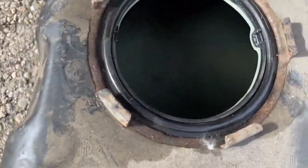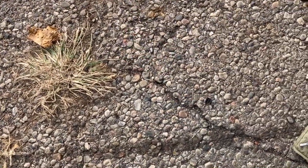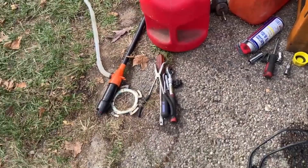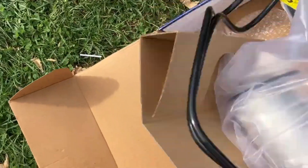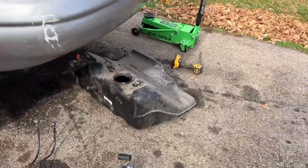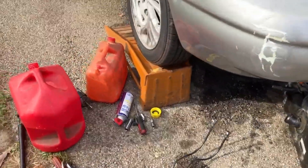I got the fuel tank down, the fuel pump out, and all the fuel drained out with my pump. This one had a dirty filter on it, and she just was not pumping. In fact, she stopped pumping altogether after I got a couple gallons of gas out - I energized the fuel pump and would not hear it running. She was on her last leg. We got the new one here, going to get it installed. My friend came over and helped me lift the tank down since it was still half a tank. Now we're ready to put it back up.